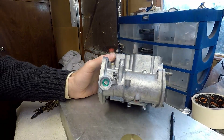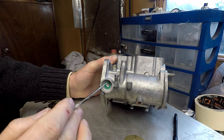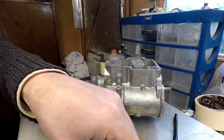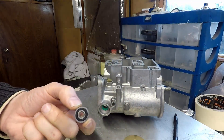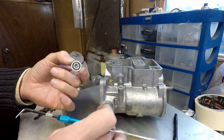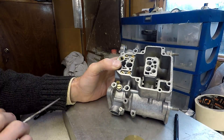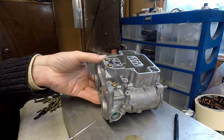This is a slightly newer carb — newer casting — and the reason you know it's a newer casting is because it's got these seals which you need to renew every time you rebuild them, because these carbs have much looser tolerances. This bearing tends to go straight in with your finger, so the tolerances are looser, whereas the others used to seal. This also has an idle bypass circuit that we're going to have to build at the end.